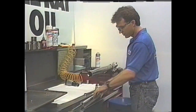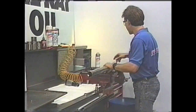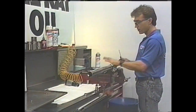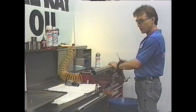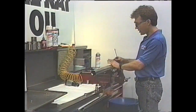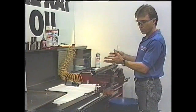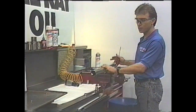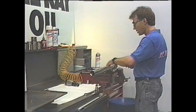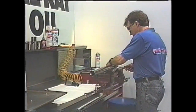Next thing here, we'll just get these out of the way. Next thing, we want to pop the seals out. Understand, if all you're going to do is get into the adjuster or get into the cartridge, you don't have to completely take the seals out and grease them up. But if you're replacing a seal or you want to do complete disassembly — we do complete disassembly almost all the time because we want to check everything out. There are some bushings in here we'll get into in a minute.